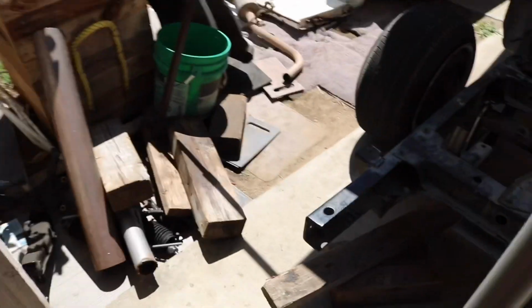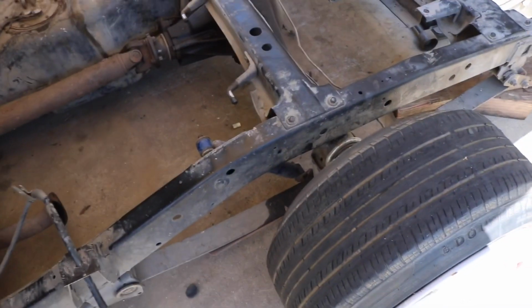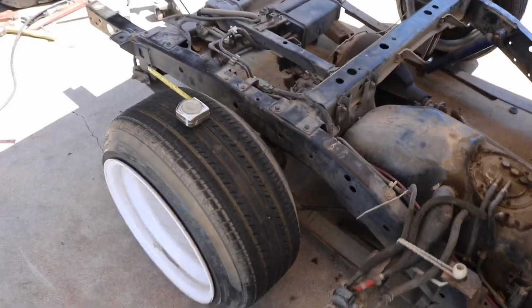And yeah, trying to drive this so low is going to be quite fun actually. I want to say it dropped about 1.5 inches from my measurements. I did it really quick. I didn't really measure that much. I just measured from the axle to the frame, and now I measured it again, and it's about 1.5 inches lower. So if you guys want to do 4-inch blocks and the monoleaf, you'll probably get like a 5.5 inch drop. So that's pretty cool.